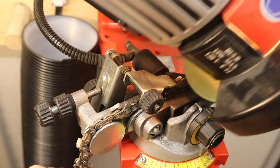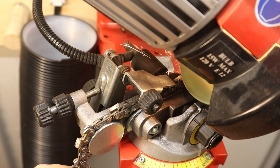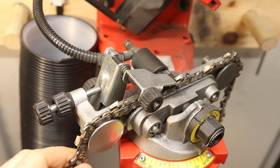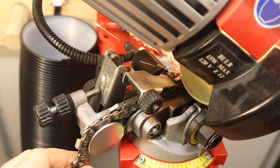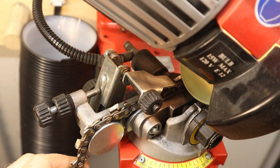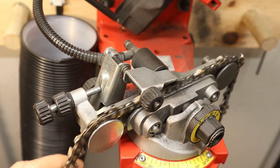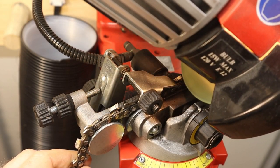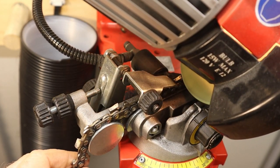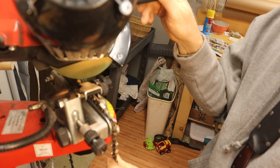You've seen me touch that dial a few times to set the amount of tooth I'm cutting off. Getting nice and close in. Little bump, tap, and then finish the cut. One thing I noticed on this set of teeth was that the right-hand cutters were significantly more worn than the left-hand cutters — I've seen stuff like that before, but not to the extent I've seen on this one. It seemed kind of relatively extreme.